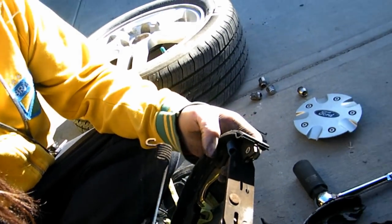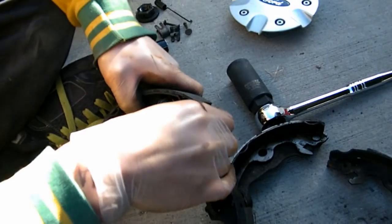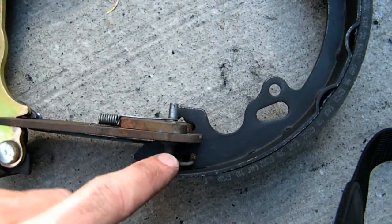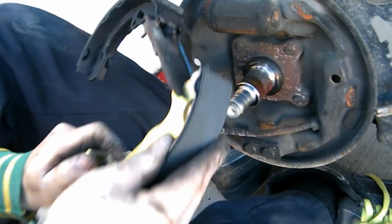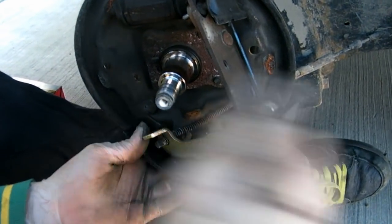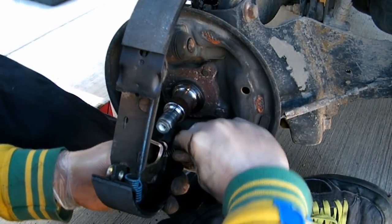Next, we've got to attach the other pad. A lot of the times when you're doing this, the spring is just going to catch and it'll make this spring right here fold over weird. I like to start by grabbing this as hard as I can and squeezing. Second step, you've got to install the e-brake cable — this might be a two-person job. You install it backwards and then flip it over 180 degrees once you've got the e-brake cable on.